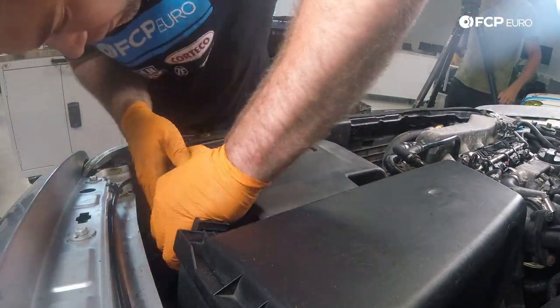That's how you replace the thermostat on this Mark 4 1.8 Turbo. If you're noticing any leaking from underneath the engine on the passenger side, it could be coming from that thermostat flange. Also, if you're noticing engine overheating, it could be that your thermostat is stuck. Not too bad of a job — a little tedious to get to some of those bolts, but overall not bad. If you like this video, please hit that like button. Any comments or questions, don't forget to comment in the box below, and don't forget to subscribe. Thank you.